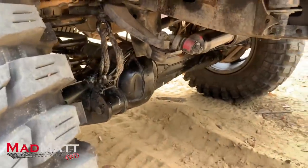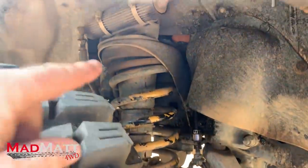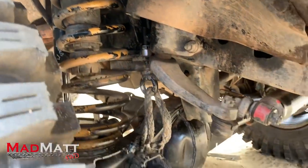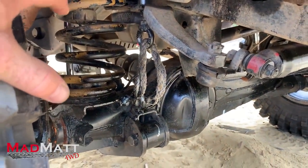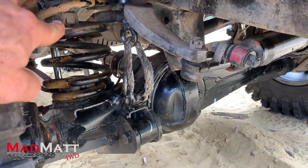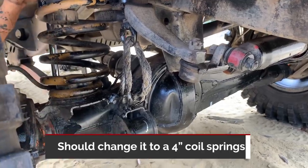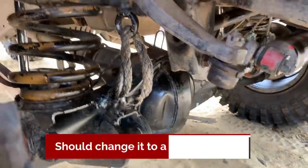Looking at the front suspension, I'm running a four inch lift in the front. Three of that is springs and then I've got a one inch coil spacer just there — that's to give me a little bit more compression space when I hit and land from jumps, to give me a bit more distance between the bump stops. So I've raised it up an inch. I should change that to coil springs but at the moment the budget's not allowing for that.